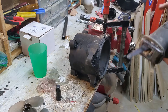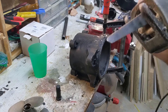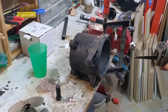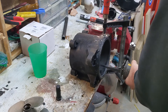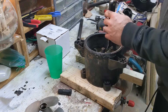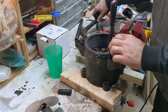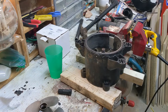You don't need a very aggressive blade for this either — in fact, the less aggressive the better. This one might even be a little bit too aggressive. Just take it slow and try not to beat up the back of the pump, and you don't want to cut all the way down into the case. Then just take a flat edge or something, finish cutting down. You're trying to remove this piece in the middle so that the whole thing will relax and you can get it out.